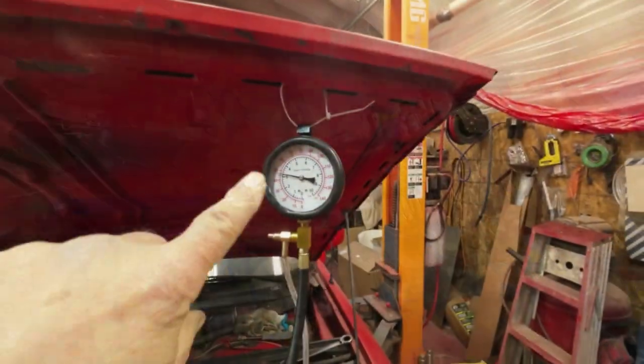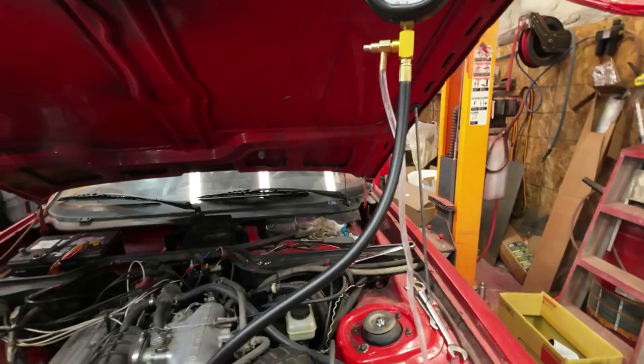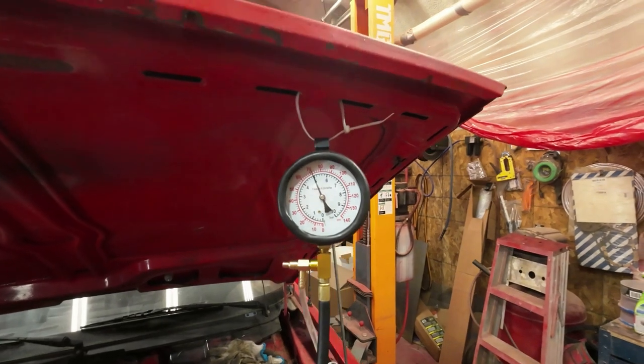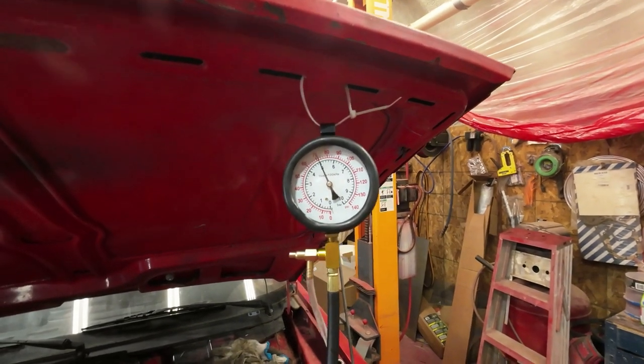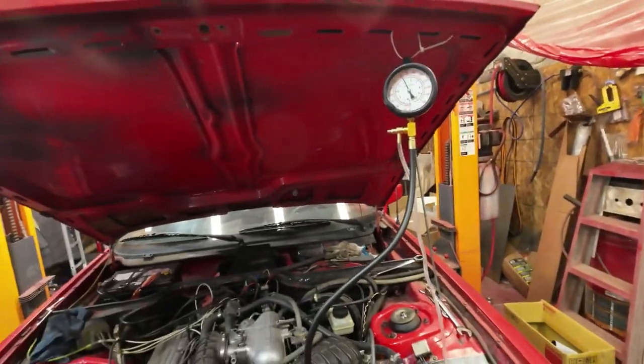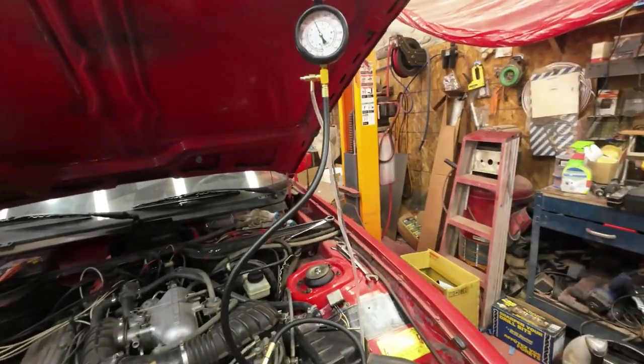I'll think about that for a minute and I'll read the book. Yeah, I'll take out one more half a shim and that should get it down to right. There, that's got the system pressure set right on 72 pounds or 5 bar. So that's right-ish, I think. I don't know if I can get any better than that.